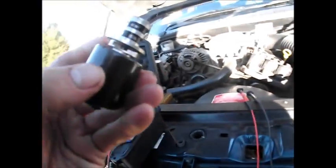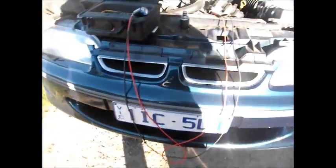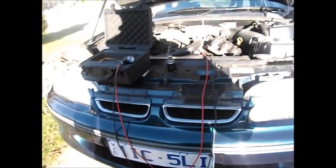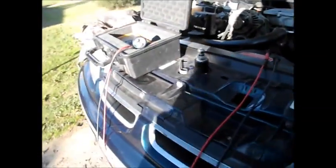The solenoid tested electrically fine, but it might have a mechanical problem. It did show up a fault code, but this thing might have a mechanical issue. I'm going to replace it and get it back together. I'm going to tighten up the spade terminals because they were not real tight. More often than not when you think the solenoid's chowdered, the real problem turns out to be that the electrical connection is crap.